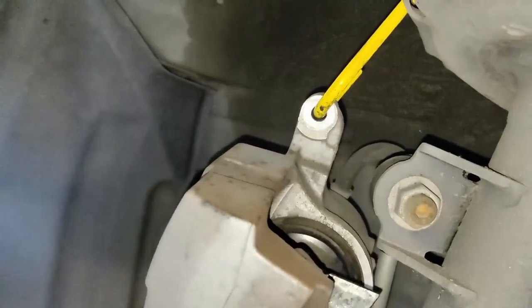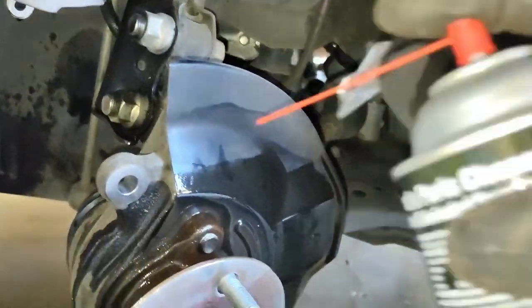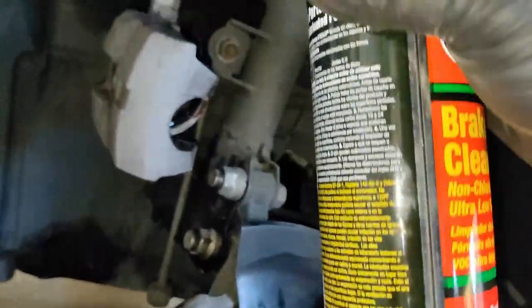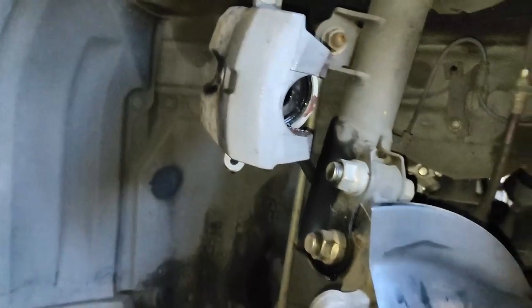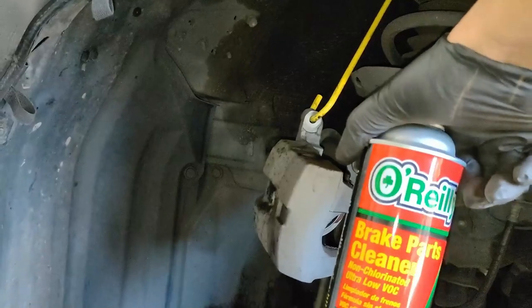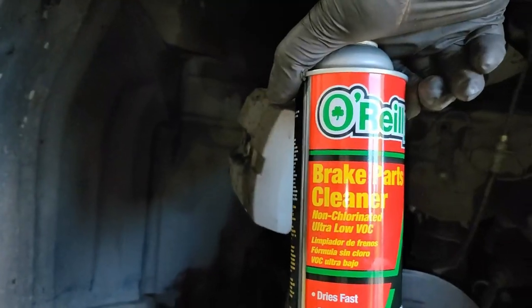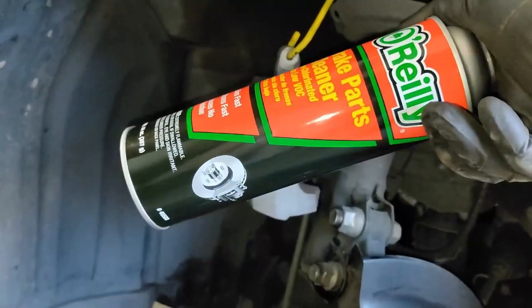The piston is nice and flush now. Back out the tool — there's the clean piston. Clean it up a little bit. Do not be cheap with your brake cleaner — I normally use one can per side, so about two cans for this whole job. Let it drip dry, which only takes a few seconds since it's alcohol based. You can get these for about $1.99 at O'Reilly's or AutoZone when they have sales.